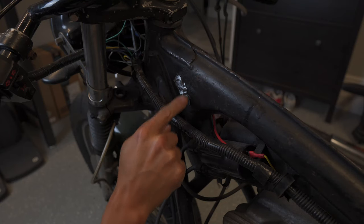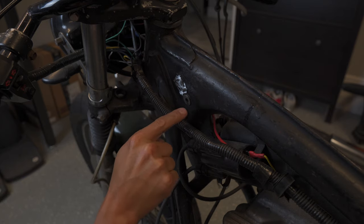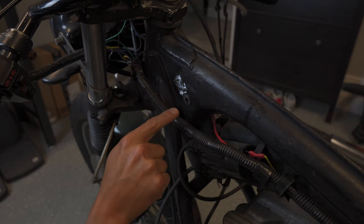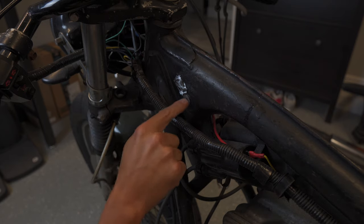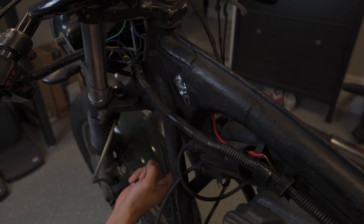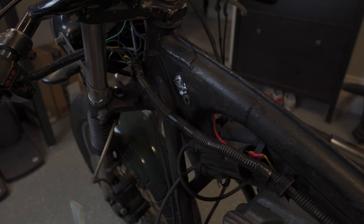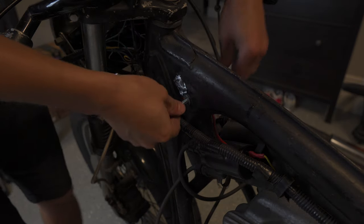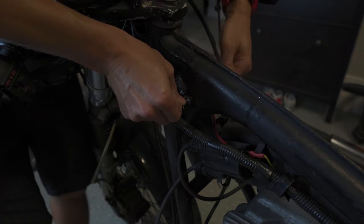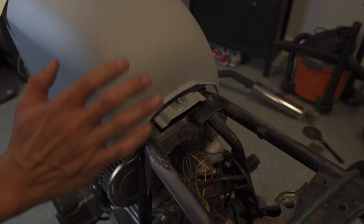The original post that was here had been cut off, and my plan was to put a rod all the way through and do a couple of tack welds. But the original tube was probably hollow — there's still a channel going all the way through, and my fear is that if I drill it out, a piece inside would fall off and rattle around in the head tube where I couldn't reach it. So since the hole was about six millimeters — just a little bit bigger — I bought a quarter-inch threaded rod that fits through perfectly. I've got a spacer and nut cut down to size, and it mounts perfectly.